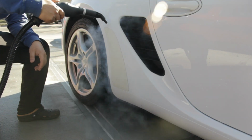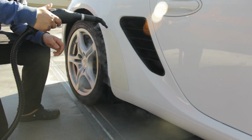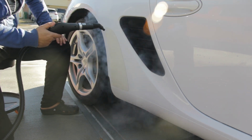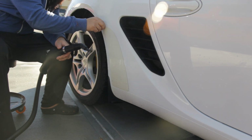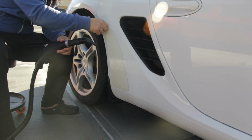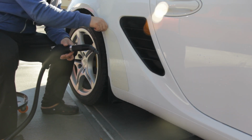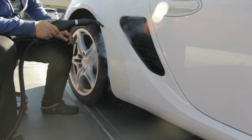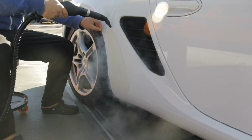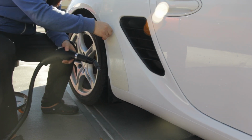We will begin by choosing our starting point and hitting it with your steamer. I decided to start from the top left corner. I went ahead and tried to warm up the entire piece, but you'll want to primarily focus on the section you are starting at. Once the film is warmed up, keep trying to lift off a corner of the film. Once you are able to lift the corner, just keep applying heat and slowly lifting a little at a time.